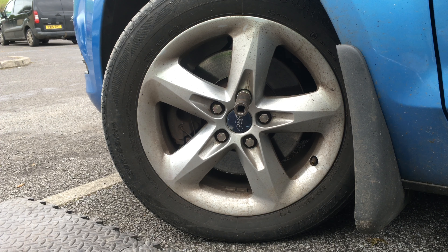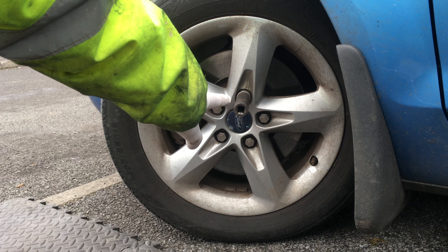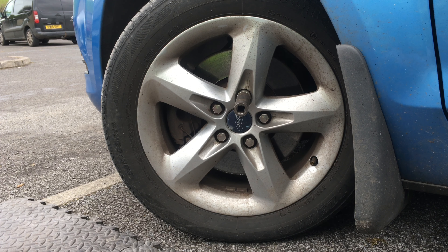So here we are on a 2008 Ford Focus. It's a 1.8L diesel. We're going to do the front coil spring on this side. I've already done the other side. We'll start by taking off the wheel. These are 19mm bolts. I recommend breaking these loose by hand always — the locking wheel nut. You don't want to bust it.